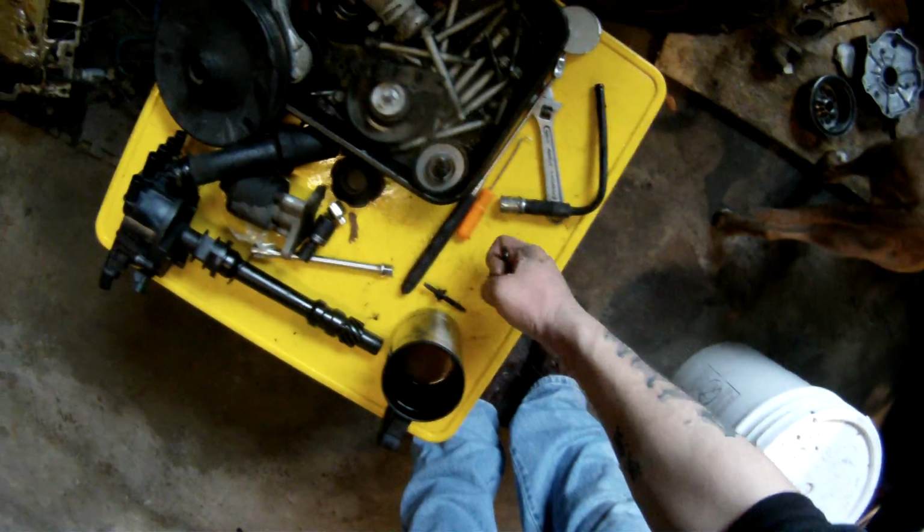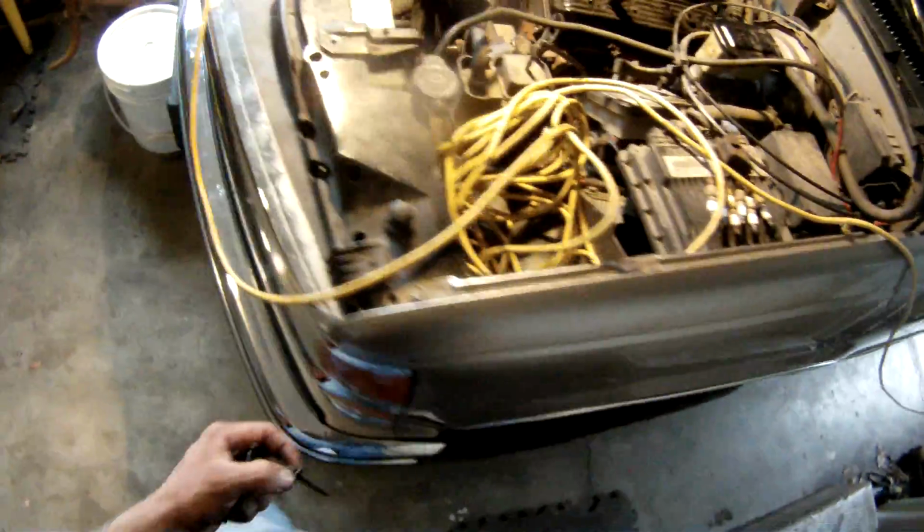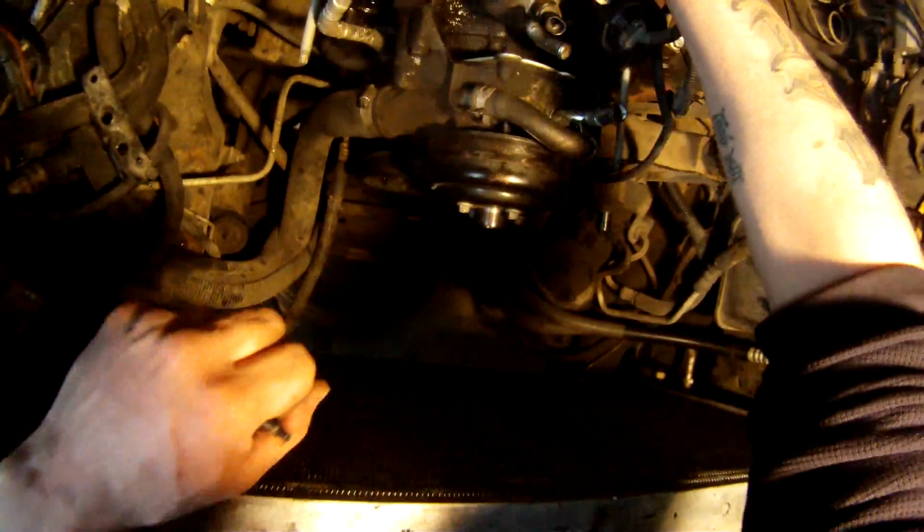Oh, I got some good news. I got everything worked out with the owner of the 85 Corvette out there. He even brought me, instead of electrical tape, heat shrink tubing. So I'm excited. I got fusible links. We got 40 feet of 18 gauge wire for low amp circuits, 13 amps, 156 watts. So yep, 18 gauge automotive wire, for low amp circuits, 40 feet. Got corrosive free solder. So hopefully we'll be able to get this thing out of here in the next few days. I've been so busy lately, just working all day, every day, around children and everything else that's going on.